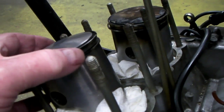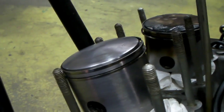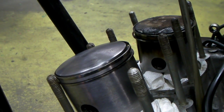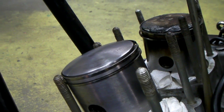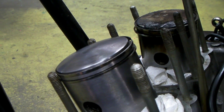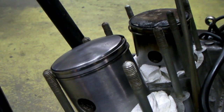These pistons have a Dykes ring on the top, kind of an L-section ring. They most never stick or get stuck. Most engines that have those are pretty good as far as rings sticking. The second ring is the one that'll get stuck. Originally this bike had what they call a keystone set of rings, which had an angle on each piston ring. They got stuck very easily, so when it had about 5,000 or 6,000 miles on it, I changed those pistons to these newer ones, probably what they use on an RD or something, but it had the Dykes rings.